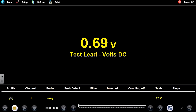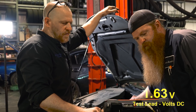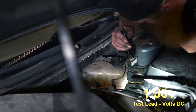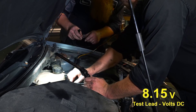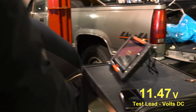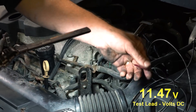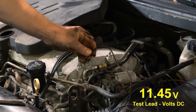I got 0.6, 0.7. I saw 12 volts, but when I grounded it, why did it go to 12? That same wire — my ground came off my meter. See that? I had 11.4. Then I just touched the ground and started the car. Hold that where it actually stays. Go try it now. Nothing — I'm turning the key, all the lights are on the dash but no crank.